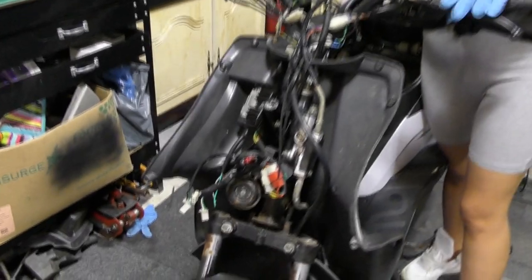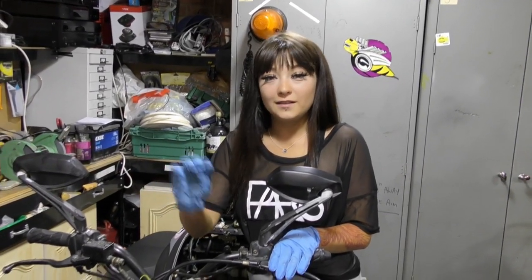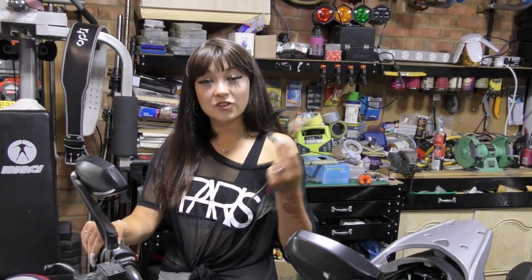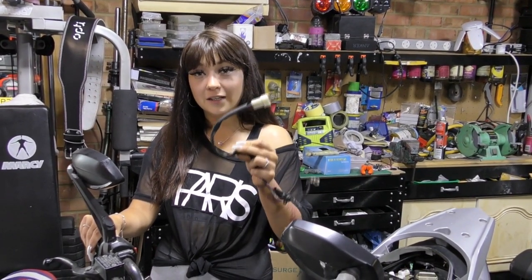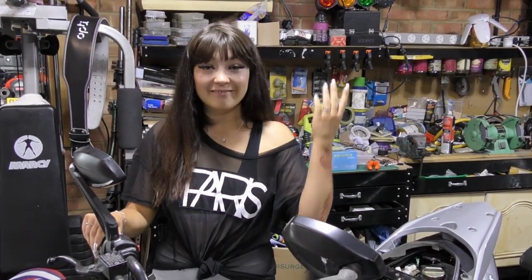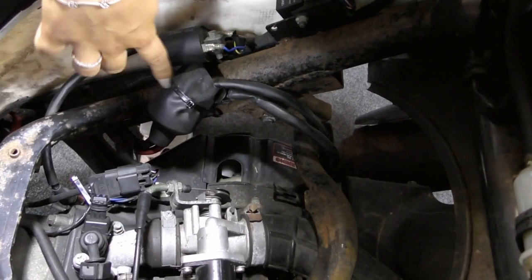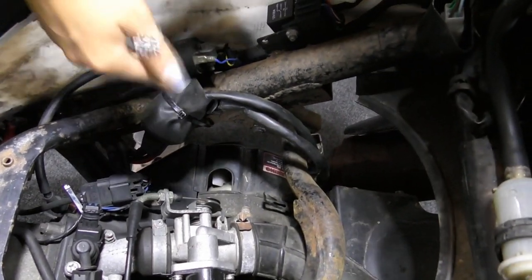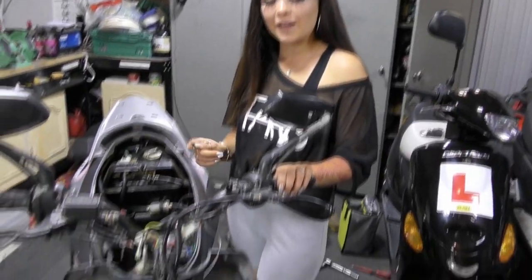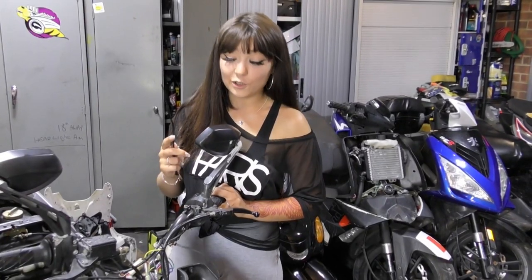So now I'm going to loosen it off, grease the top and bottom, and then tighten it back up again, then lock the top nut down. That's the first bit of good news that we've had on the bike. I've just taken this off from what the last owner left on there when he changed the starter motor - we don't need that anymore. I know I hate cable ties, but sometimes you really do have to use them - in this case to place the electrical cables out of the way and remove them from any moisture, which he left dangling down. We're going to get the front panels back on with proper screws and proper bolts to make sure it's all secure.